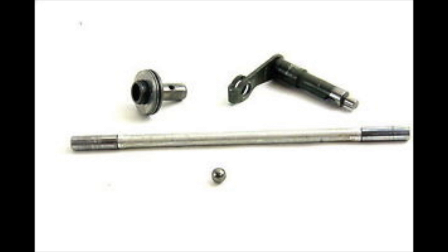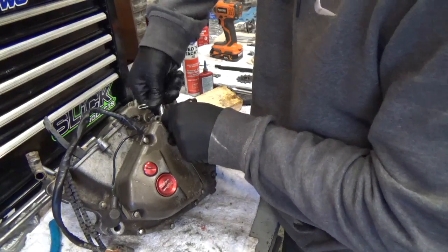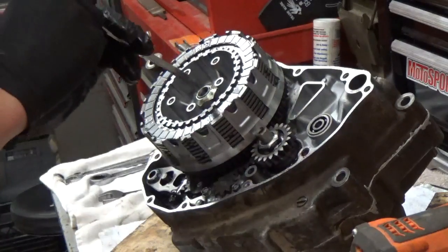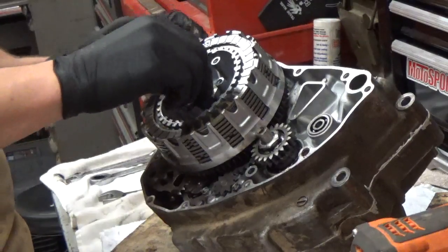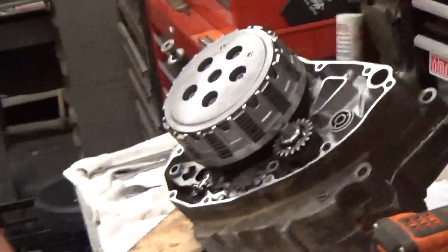I'll show a little video of me installing the clutch actuating arm and what will happen if you do it the wrong way. Here I am skipping the step — I tried putting the actuator in and it's not going in because the rod is pushed up against where the actuating arm should be. So after you have your actuating arm in, you're going to slide your rod in. The ball is already in that pin, but put the ball and then the top plate on.